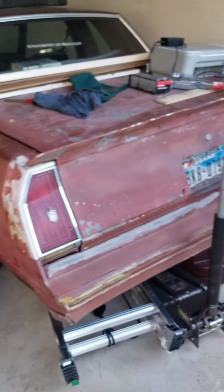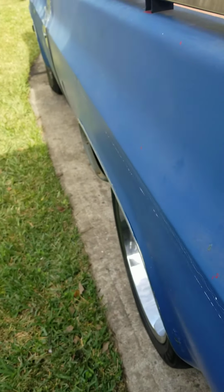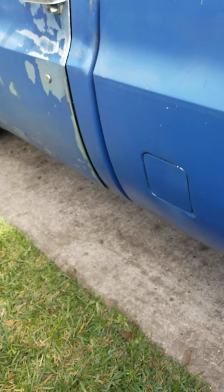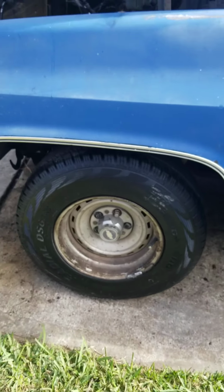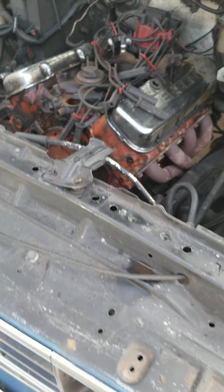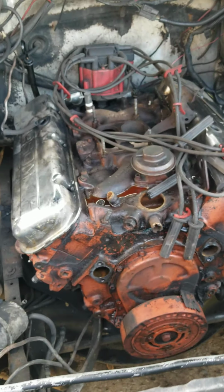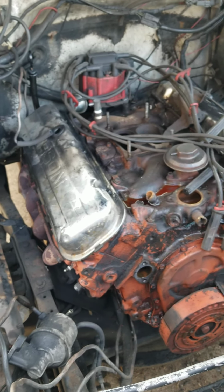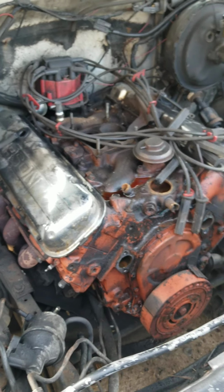one time I was an engine builder. That was what I did, and raced and stuff like that. So from the knowledge of what goes on with the engine and the knocks and different little sounds, it had a slight little knock to it, but it wasn't a knock as if it was throwing a rod. It was a tapping like you would have with a loose rocker arm or something like that.